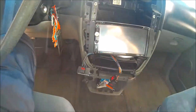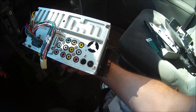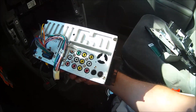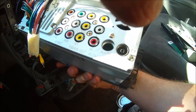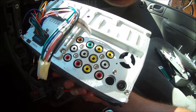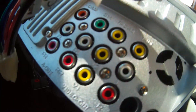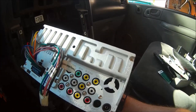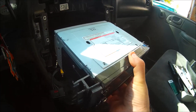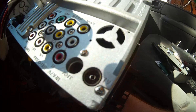If you're looking for a stereo install, this video is not for you. On the back side of my stereo, everybody has different stereo setups, but they are pretty much generally the same — just slight differences. You've got antenna, speaker setups, amp setups, and then in yellow you have rear video camera. We are going to hook up an RCA jack right there — that top one that says rear camera. This is just a cheap Chinese stereo but it works very well. It has all the bells and whistles. You also have a front camera and rear input.